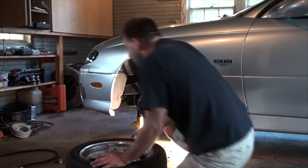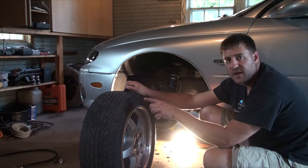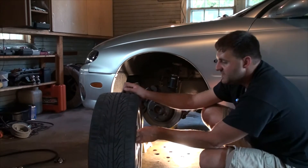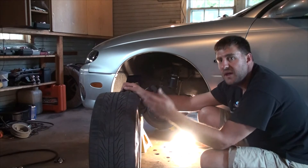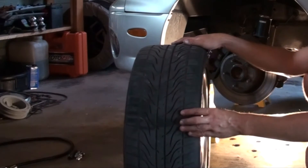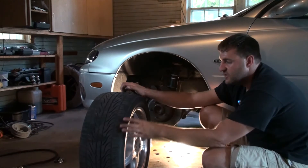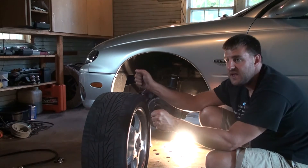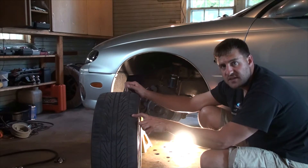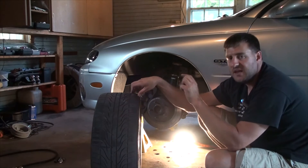The last term is toe. Toe is basically the straight-line position of the wheel. You'd think that with the steering wheel perfectly straight, all four wheels aim right down the road — not so. From the factory they build in a little bit of either positive or negative toe depending on the car, the suspension setup, and the tires. Dialing in toe-in increases stability, making the car less susceptible to bouncing around on the road. The downside is too much toe-in wears the tires a lot faster because the tire is being forced to turn in all the time.